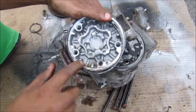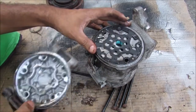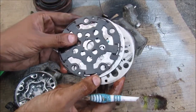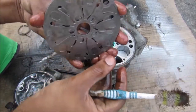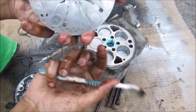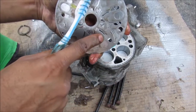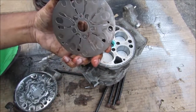Inside you can see there's an oily substance that aids with lubrication. Over here on the compressor we have the reed valve assembly — essentially a bunch of plates put together to form a one-way, self-regulating pressure valve. This little valve lifts up when pressure is pushed from the other side allowing refrigerant to move through, but when the piston moves in the opposite direction it closes off and acts as a one-way valve, not allowing refrigerant to pass back through.